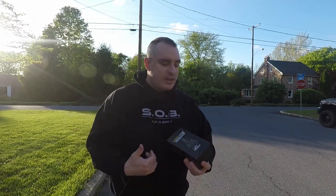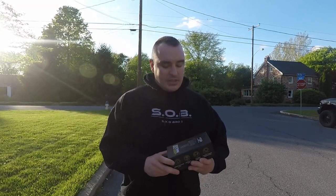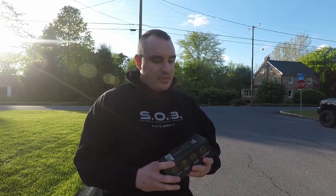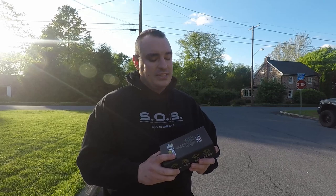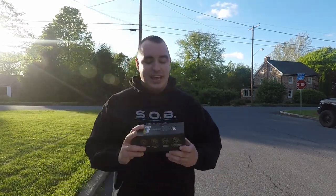So what does this do? I was talking with the owner today about this. Basically, for factory applications, manufacturers have to consider the cost of releasing a product. In the aftermarket, they still do, but not as much because you're paying for that performance. The guys at Turbo Time looked at the turbo — they already have great wheels out — and decided to attack the solenoid itself. The factory solenoid doesn't work badly, it just doesn't work as well as it could. As the turbo spins and creates back pressure against the vanes, that solenoid isn't always able to push the vanes into the ideal position, leaving some performance on the table — which is what the Lightning Bolt addresses.